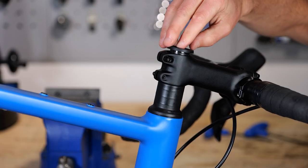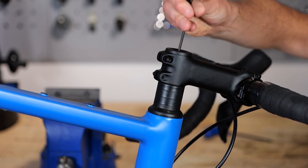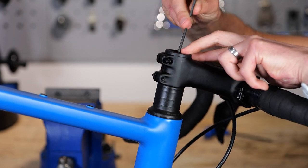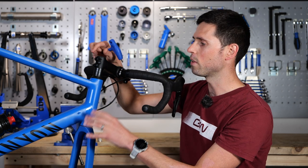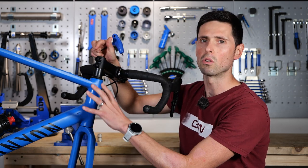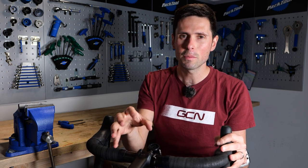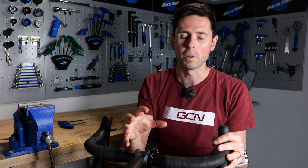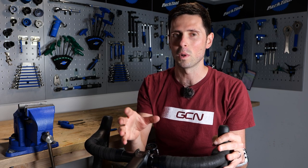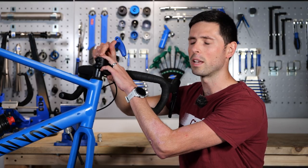We've got the top cap and bolt next. This threads down into the expander bolt which is held securely in place in the steerer of your fork. This is the important part, because it's this top cap and bolt which allow you to add a little bit of preload into the whole system and remove any free play within the bearing or any of the additional components in there. If you're wondering what on earth is free play — it's excess movement between the bearing races, the frame, and the steerer tube which runs all the way up through the middle; it's movement that we don't want to be there. The only movement we want to allow is that rotational or twisting movement that's allowing the bike to steer.